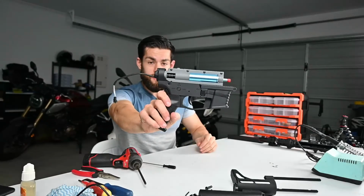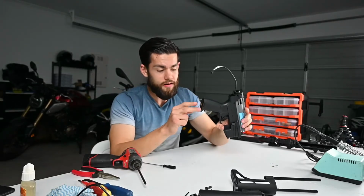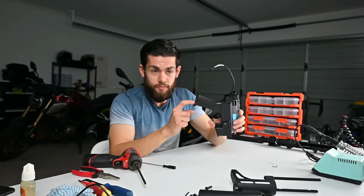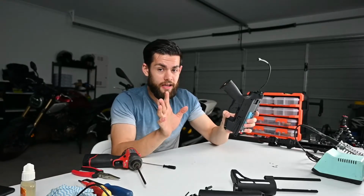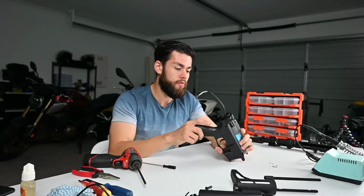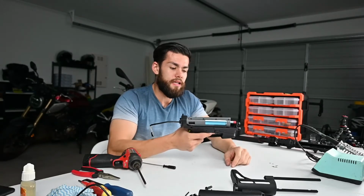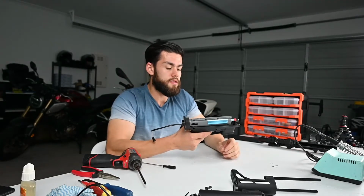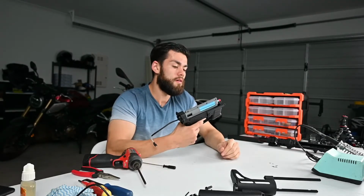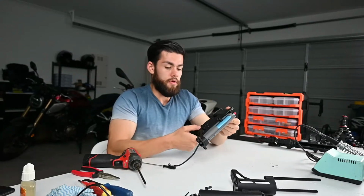Anyway, hopefully you saw what I did there. So I've put this bottom on, I've slid the motor in. When you connect the motor terminals, there is one painted red, that's for your active. The other one's usually clear, that's for your black, which is your neutral. Ideally, I'll put it all back together and then I'll test it, because I'm pretty confident this is going to work.